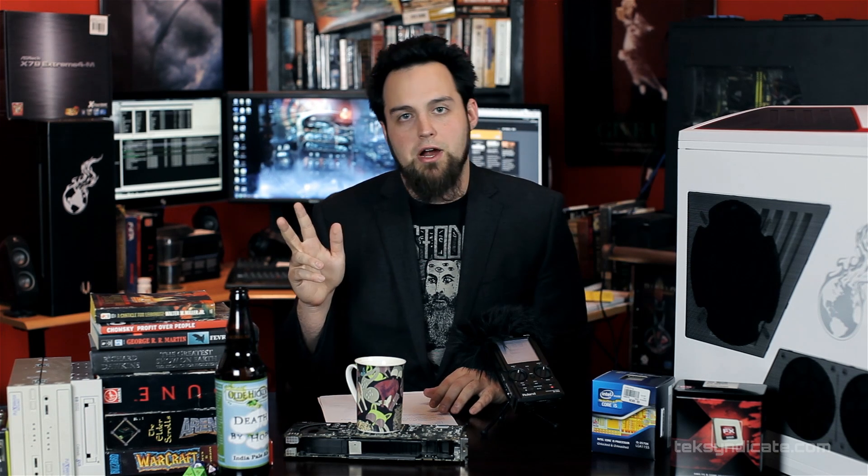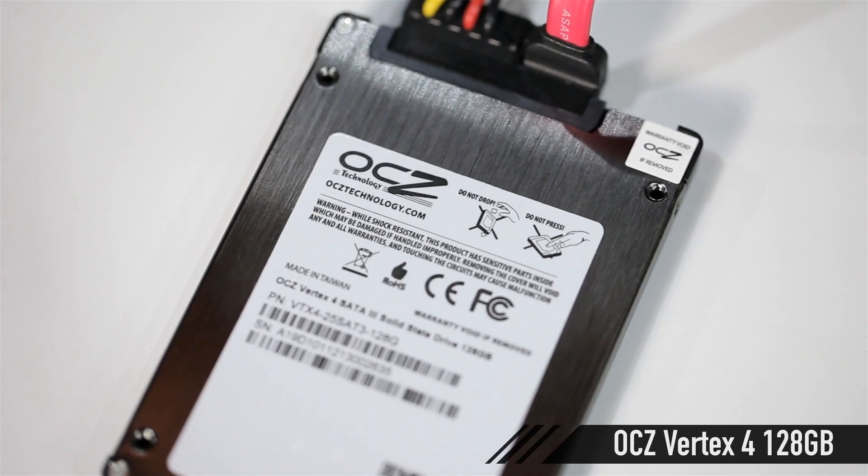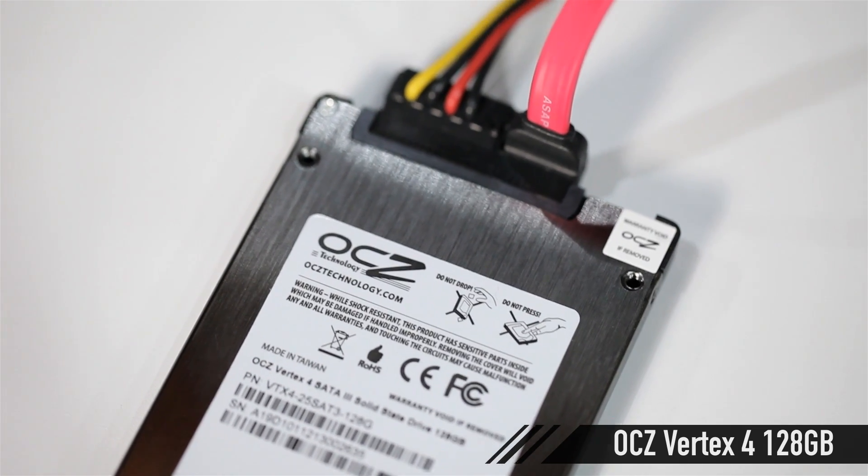For storage, I'm going to go with two different drives — one drive for the OS and some programs, and then a second drive just for storage. For the OS, we're grabbing the OCZ Vertex 4, the 128GB flavor. I like the Indilinx controller a lot. The IOPS are absurd. I tested this against the Kingston and the ADATA we have, and the read and write speeds were only a few megabytes per second slower, but the IOPS and random performance were really, really crazy. So I like that one a lot and it's at a good price right now.